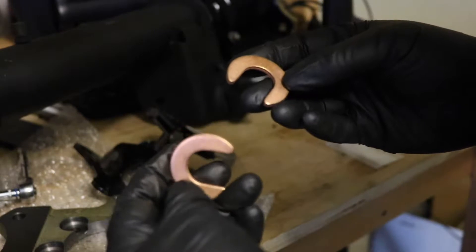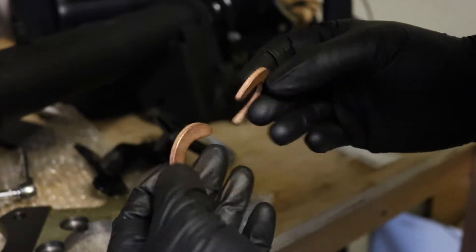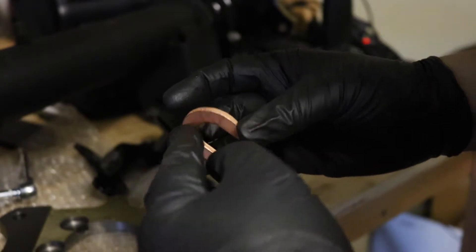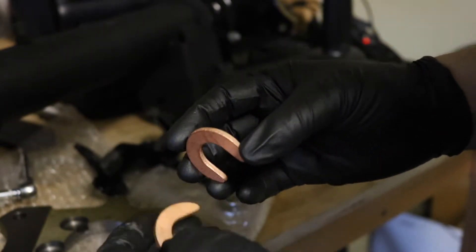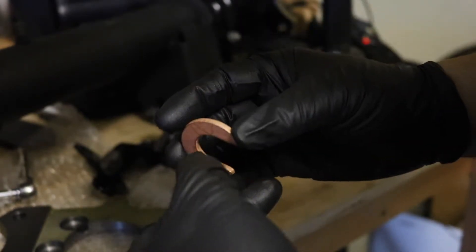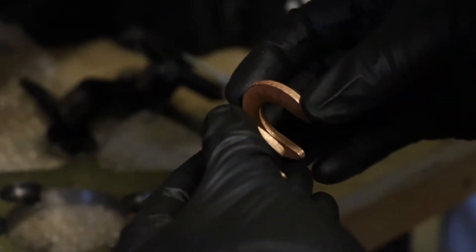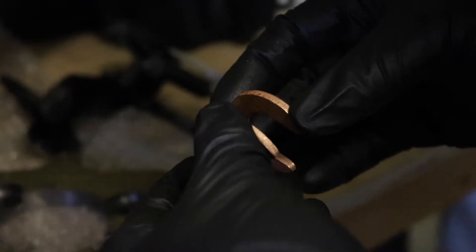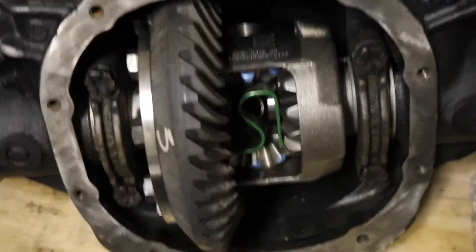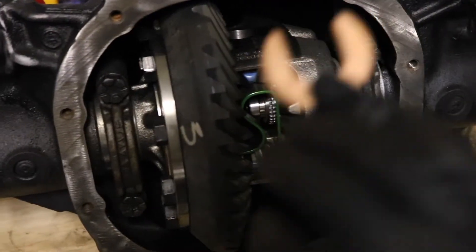When you install your axles, you're going to need some new C-clips — and these are brand new C-clips. There's a difference to each side: there is a rounded side and a flat side. It is imperative that you have the rounded side facing outside towards the wheel, and the flat side inside towards the hub. So essentially they would sandwich — remember, flat side in.